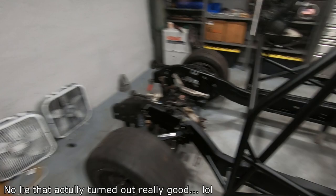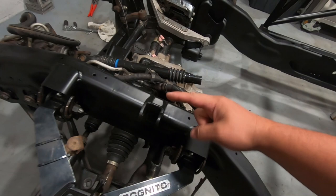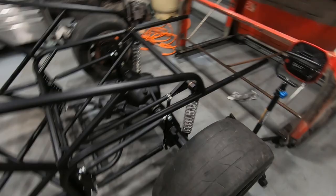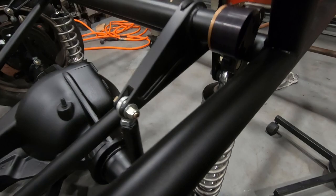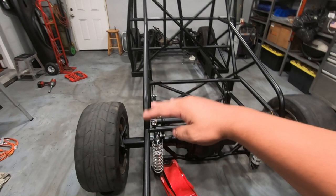We got everything back in its place up front here, got it sitting on the bump stops right now so we can roll it. I also added another plate in between our upper coil mount - this is just so that the brackets can't go forward and back, and it's also welded flat across this bottom here to the chassis. Hopefully that will give it a little bit more added strength when the coil is pushing up against it. Front end completely done, and as far as the rear end, this is how it will be when it's assembled for the final time. This ARB looks killer in black - I didn't know if I was going to like it like that with the nice billet arms, but I kind of like the look of it all black.